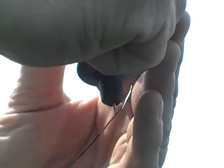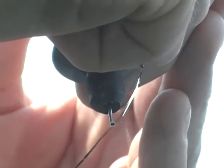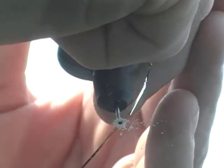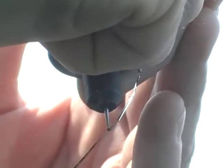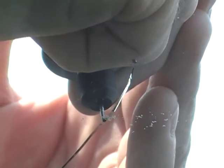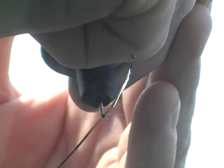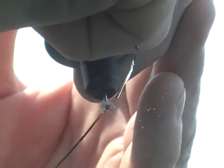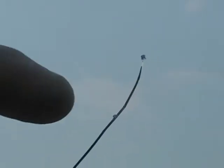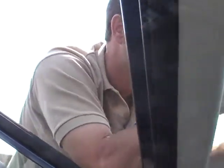Press real lightly and just let it cut down slowly. For the second drill, go about an inch below your first drill on the crack. We're going to drill all the way to the plastic on both holes. You'll be able to feel the difference as you go through the glass — it's hard, you can see the glass being shaved out, and then once you get to the plastic it's real soft and goes pretty quick. Once you get to the plastic, stop. You'll see it makes a little dimple, and you can tell that you've got into the plastic.